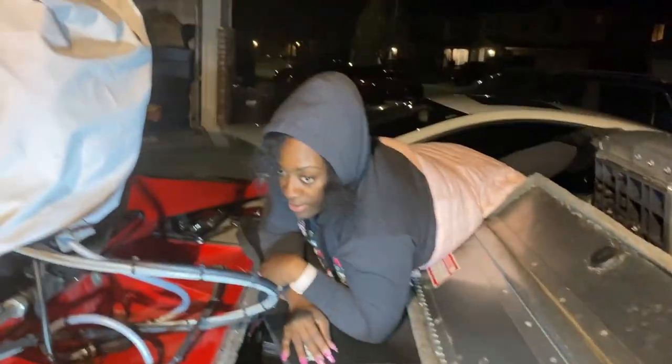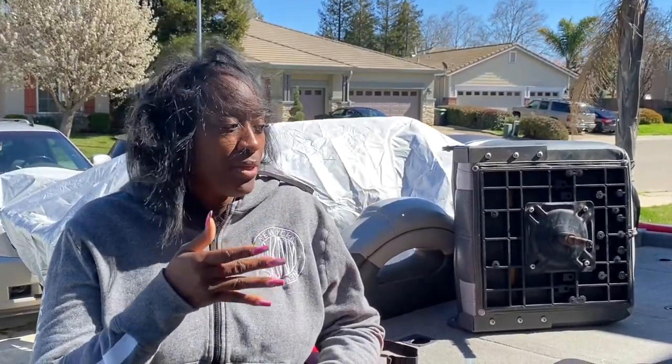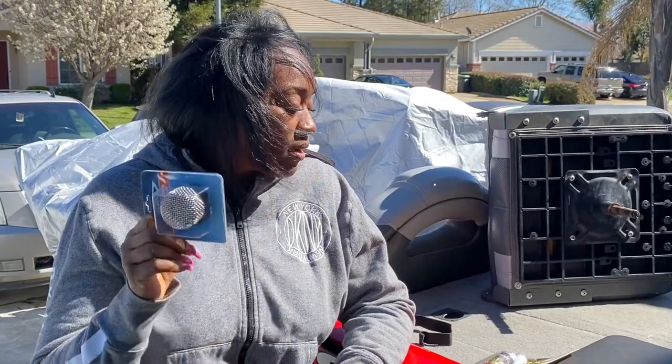This is a crazy job - it's tough and it's cold. This is part two - the other night we were doing it and it was super cold, so we got halfway done. It was dark so we really couldn't see what we were doing, so now we're going to finish it. The aerator strainer was not on the boat, so we had to go ahead and try to repair that. What happened was the previous owner looks like they were trying to replace it, but they cut off the nozzle too close, which I'll show you guys again up close. You can't screw this on - I get why they cut it because it's so awkward trying to get it into that space, but they cut off too much. I think they just said forget it, but we want to use our live well, so we're going to repair it.